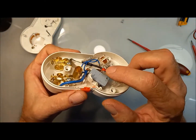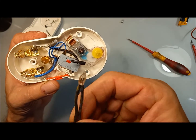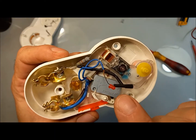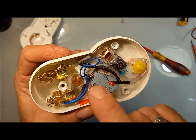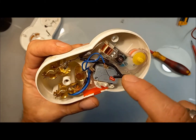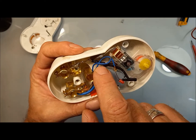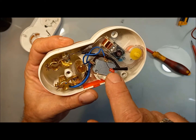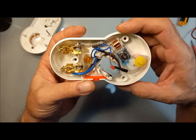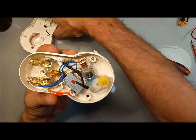You see here what they have here is a LED. Normally they have these funny lights that work with AC. It's a gas lamp with a resistor, but this is old technology. This is a LED, but with a LED, when you use it like on a 12-volt battery or something, you use a 600 ohm resistor or whatever. But with 220 volt, firstly you need to rectify it. You need to put a diode in, and you need to put a higher wattage resistor in it, because of the small amps with high voltage. You need like a 5 watt or a 2 watt resistor, otherwise it overheats. Okay, so this is an override. Now let's put this thing back together again and then see if it works.